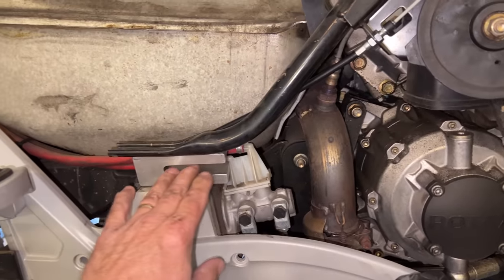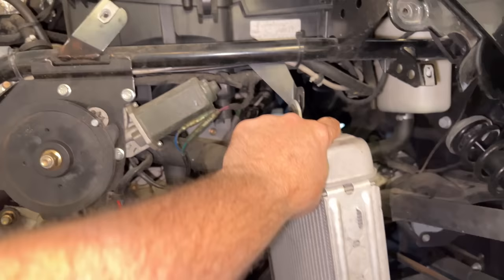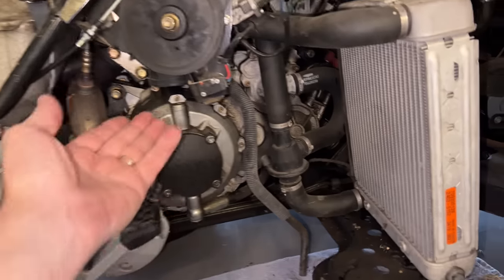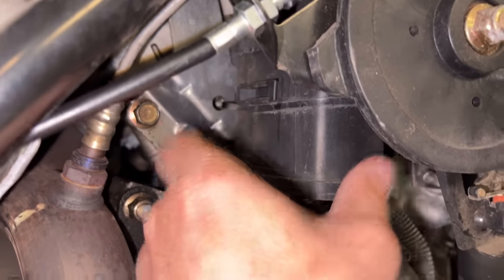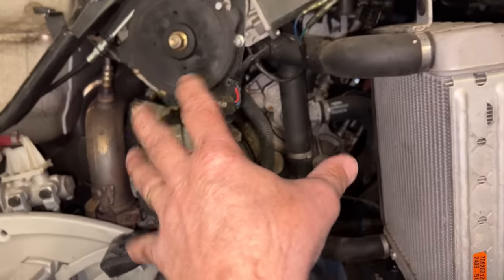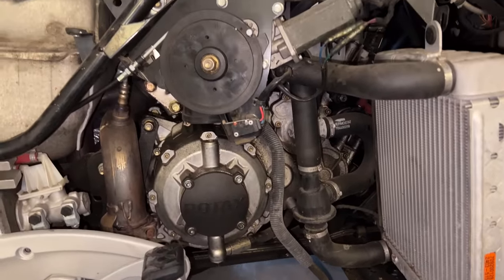Ideally you're supposed to take that lateral support out, but then you're taking the tub off. I use an old connecting rod holding tool — for putting cylinders back on, an old Honda tool — that brings it up enough that the radiator clears its mount. You can see how the mount's no longer lining up because it's lifting. Then just walk the cover out — there's enough room. Knock your evap bottle; you can see there's a zip tie that kind of key-locks in there and keeps it from moving. Get all the screws, pull the cover, twist it a certain way and finish it off.